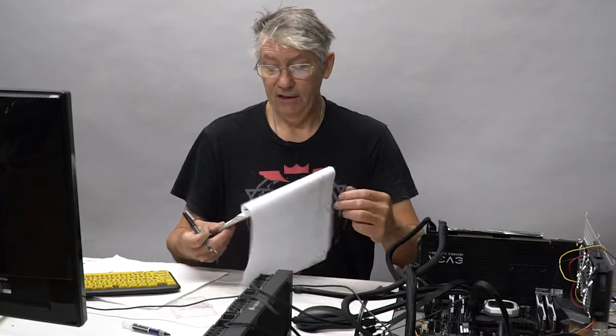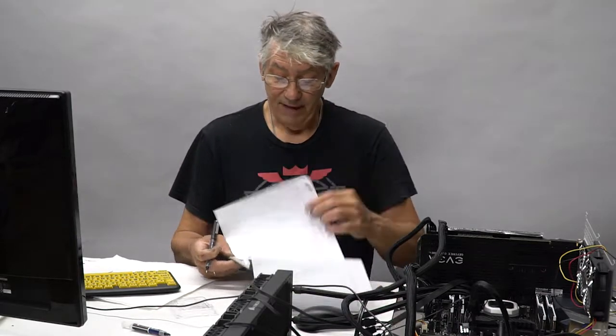Now, let's see. With the new delidding, my Cinebench will start off with that first. Again, same overclock settings as before. I got a 3177, slightly higher score. My maximum temp was 64 degrees. That was core 1. That was 64 degrees as opposed to 78 degrees. So it was a 14 degree drop in Cinebench.